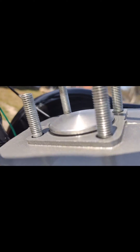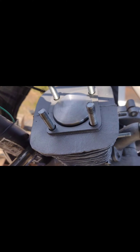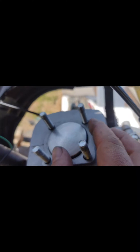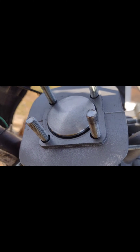Take a look at that deck height — clearly the wrong piston, or maybe the wrong cylinder for this engine. When I emailed TDR Moto they said send a photo of what we sent. So I sent a photo of the piston and the jug, and they came back saying no, we didn't send you that piston, that's not something we stock — all their pistons have the exhaust triangle. So I sent the dimensions of the piston and they said oh it's the correct piston, just a different type, but clearly something's really not right.